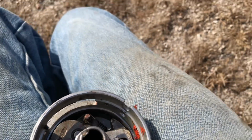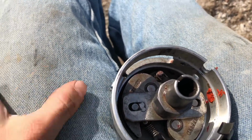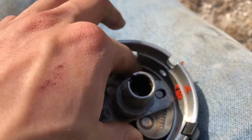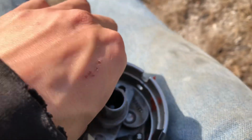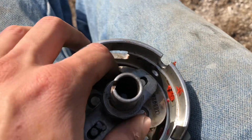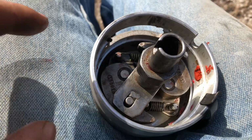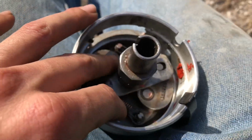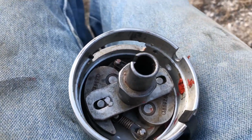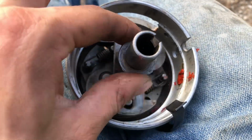Since I was pulling a heavy car with, well, at the time, 410s, it was pulling really hard, it would make the engine knock. And by the way, I am running 87 octane, so I'm running the cheaper stuff. And yes, I'm running the ethanol. I haven't had a problem with it yet. I don't believe this is the problem. The car has sat for a while because of the cam issue. But I did take the carburetor apart and clean it, and go through the ignition.